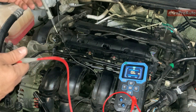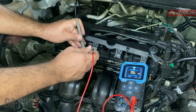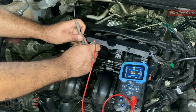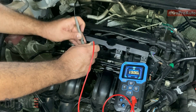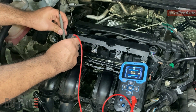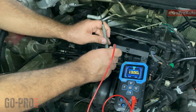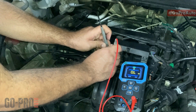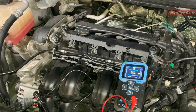As I showed you, the injector is right there. I'm going to check the resistance across the pins on each injector. I'm getting 13.5 ohms for injector number one — same story for number three — same story again. This confirms that the electronic side of the injectors is working properly with no issues.